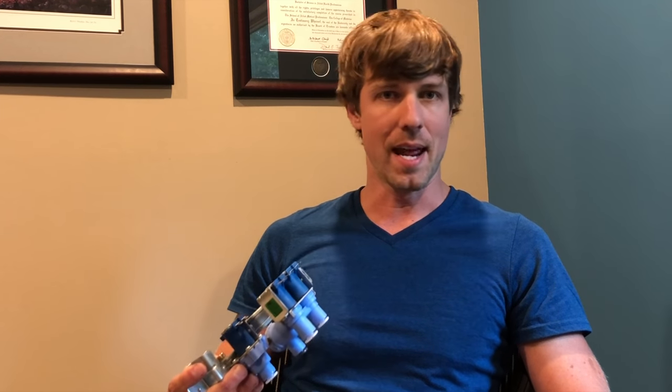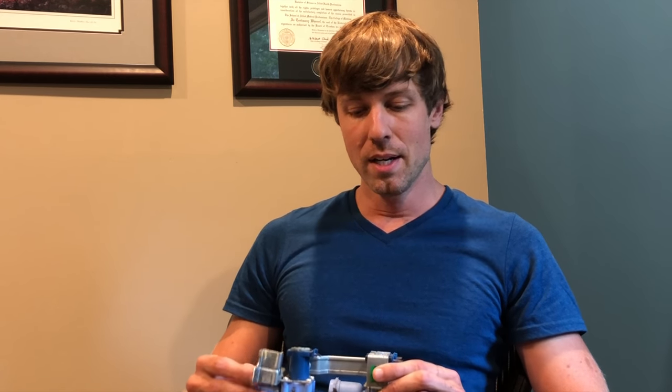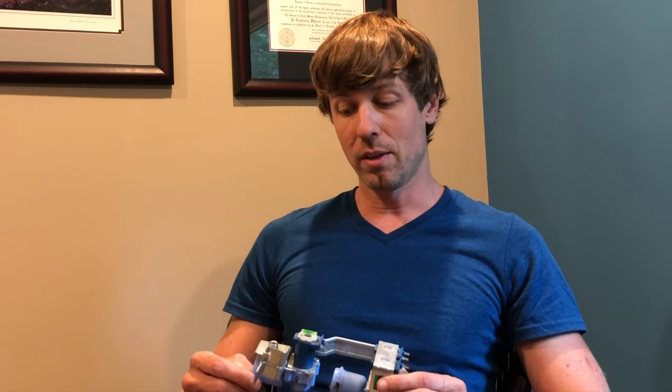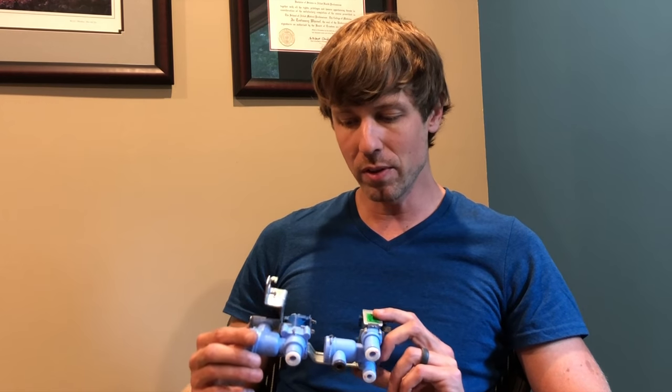there's a really high probability that your inlet valve is bad. What is an inlet valve? Well, this is the inlet valve from my refrigerator. It's a bit of a misleading name because in addition to being the inlet valve for the water supply going to the refrigerator, it also consists of two additional valves that route water to your ice maker and to your water dispenser.